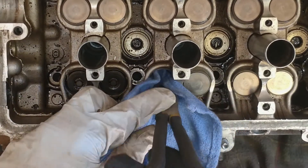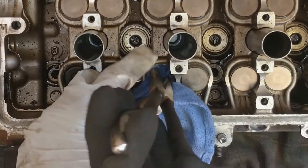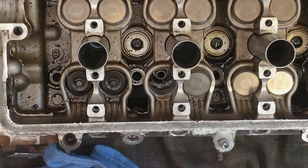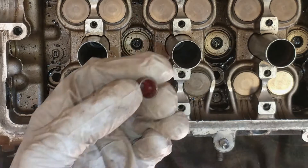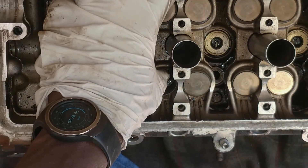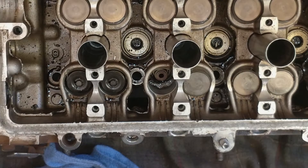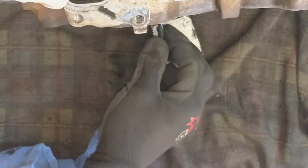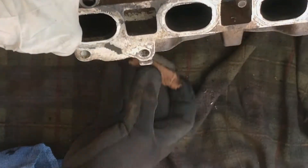Please don't judge — purists in the house, this is a quick job. I'm just showcasing the process, because usually I would have had this head cleaned good enough for the queen to eat off of, but we're on the clock and the vehicle needs to get out. Replacement seal — lube it up, not too much, just a bit. The tweezer comes in handy to hold it, put it back in place. Once it's seated, just finger-press it to make sure the seat is aligned. Once it stops moving side to side you know you're good. Get your valve, wipe it down, flip the head over, insert the valve nice and slowly — pops in place.